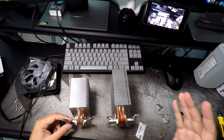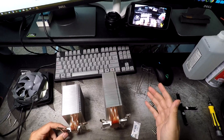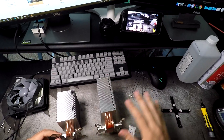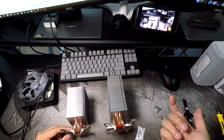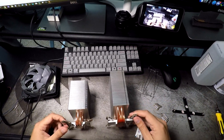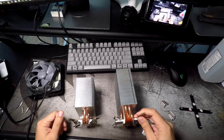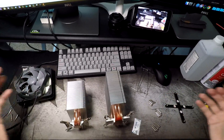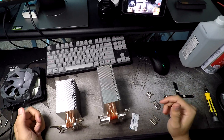Semi-passive means the fan will turn off if it's under 40% PWM — if the fan speed is low enough, the fan just shuts off completely. I think that's a really neat feature, especially for power saving. They have high confidence that these heat sinks will do well enough passive, and if you've got a fan in the back and a couple fans in the front, you'll get a little airflow over it anyway.